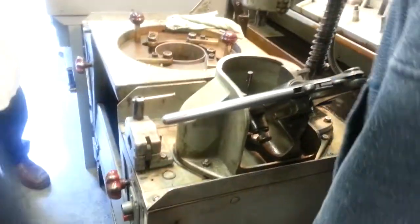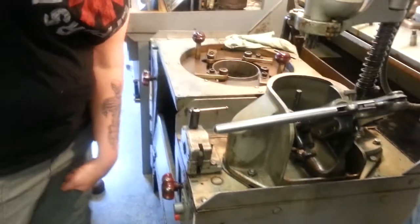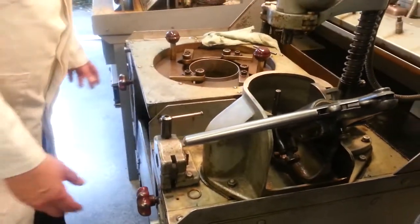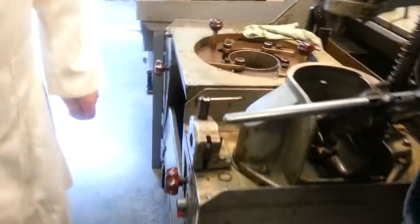What we want is to have the coolant flowing right about where we're grinding. It seems to be doing that quite effectively. And you have a flow control here — these are also flow controls — and you can adjust them appropriately.